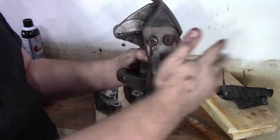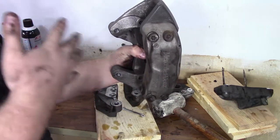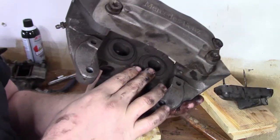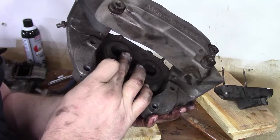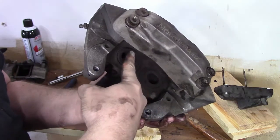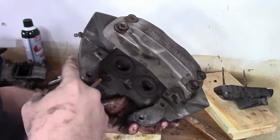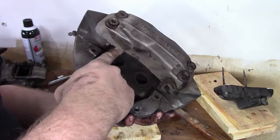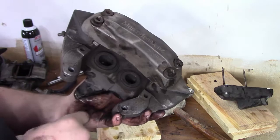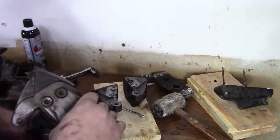So with this thing the same way, the wheel is here, but the front of the Crossfire is here, whereas on the AMG C32, the front's on this side. So what you end up running into is in here, you can see that there's a smaller and a bigger piston. So as the brake rotor rolls through, this one grabs first and then this one. If you just have it the other way, your rotor is going to be spinning this way and the big one's going to catch first, followed by the small one. So what I'm doing is swapping these pieces onto the brackets.